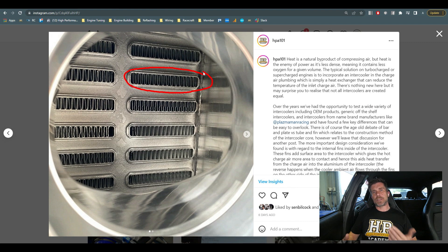I did come across a range of intercoolers coming into New Zealand from one of the Chinese suppliers, and it looked like they'd changed their tooling. We ran one of these intercoolers on a car and it just made no power — the intake air temperatures were stratospheric, absolutely ridiculous even at moderate boost.